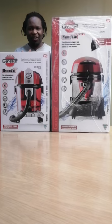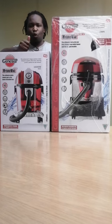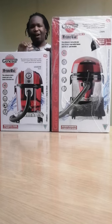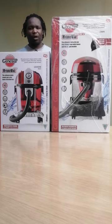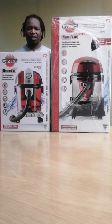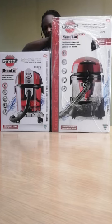Why do I have both of these machines here? It's because most people often mistake these machines — they will buy this at a later stage and query whether it can wash carpets. So I decided to bring these two brothers: this is the younger brother and this is the bigger brother. There is one thing you need to focus on when buying a machine that can actually wash stains — it has to have two tanks. One tank for the water and chemicals, and one for the dirty water after you've extracted it back from the floor.